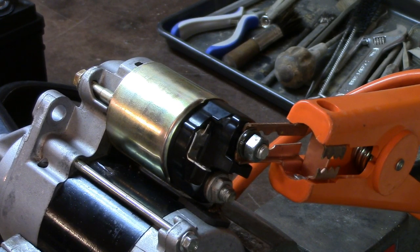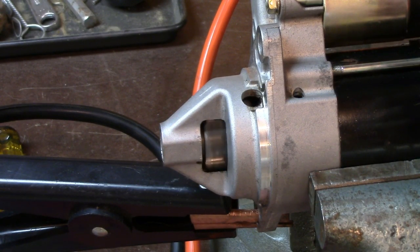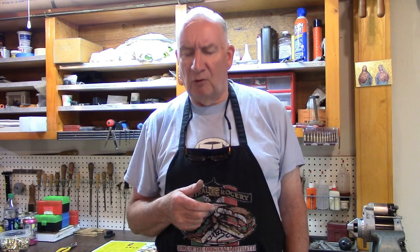Let's take a look at that pinion gear and see how that's operating. There you go. I hope I saved somebody a little bit of time, aggravation, and maybe some money too — shop time costs a lot of money, and there's aggravation and downtime. It's a very simple thing to check your starter out: just jump the positive lead from your battery to the ignition-side spade lug on the solenoid. If things don't turn over, and you don't have current flowing to the spade lug, then you may have a fusible link blown on your generator or other equipment, or maybe your ignition switch is going bad. But this is how you check out your starter.